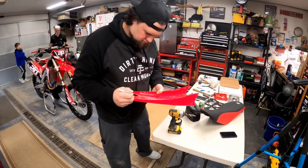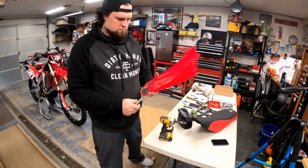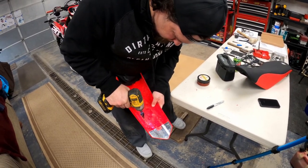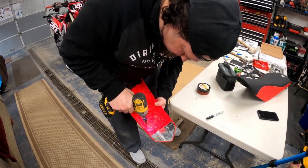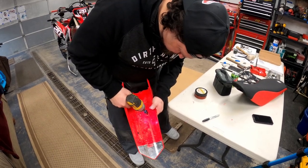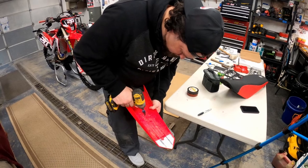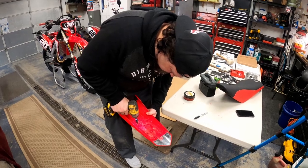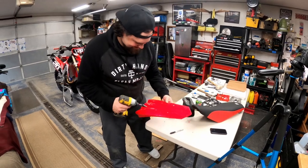When Dan drilled his fender I forgot to film it, so he's going to show us the step drill through my fender. What he did is he got a little hole through and then to finish it off, we actually came from the top down. Sometimes if you're drilling through something, the other side can peel out — it just doesn't look as clean as the top. So that's what we're doing. And if Dan does it wrong, he can buy me a new fender.